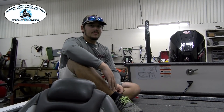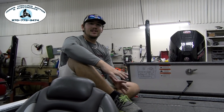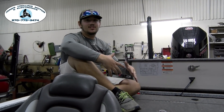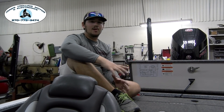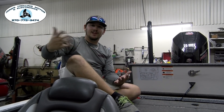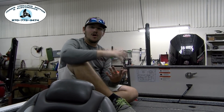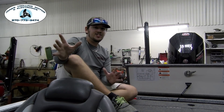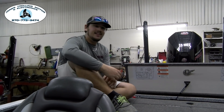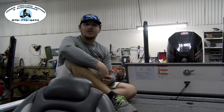If you're on an older boat and you don't have one, there's normally some kind of shutoff breaker in there somewhere. It may not be readily accessible like how these jump switches are in the new boats, but normally there's a breaker that would be trippable so you could trip it and not have that backflow happening. The other thing that can cause it is water in your trolling motor lower unit. If you're just having that issue mainly at the front of your boat on your trolling motor and not seeing it on your jack plate or something like that, you'd want to check for water in your lower unit or have a service center check.